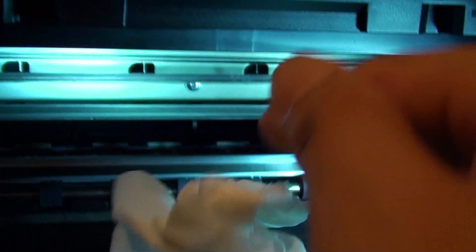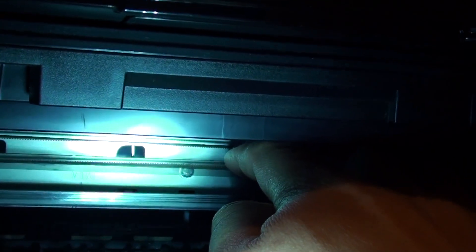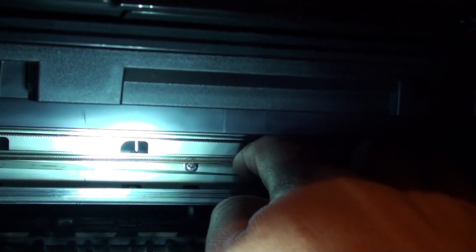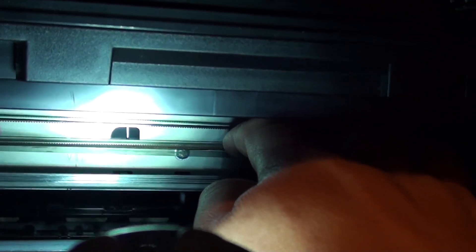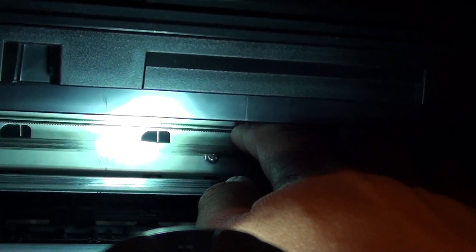It sits just in front of the timing belt. It is a bit hard to show you where it is because it is transparent, but there is a white plastic strip right there — make sure you have that clean. Below that is also a black metal strip running across; make sure you have that one clean too. Use a soft piece of tissue to clean it and make sure there is no dirt or ink stuck to it. Once you have that clean, your printer head should work properly and the error should go away.